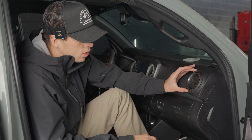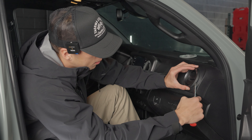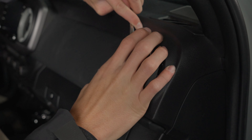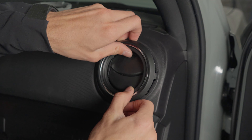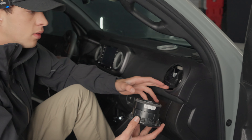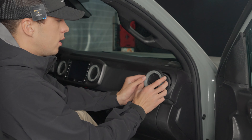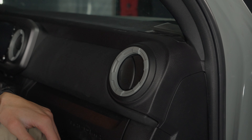In order to take this side off, you'll use a little pry tool. There are about six clips around the outside and you just kind of want to get it in here as gently as possible so you don't scratch your plastic — work it up. Once you have it most of the way off, you can use your hands and it should just slide out. Once you do this, you'll want to repeat the process that you've seen on the other rings — removing this from the housing, getting rid of the little green welds, removing the chrome piece, and replacing it with your new one. After you've removed the chrome piece and replaced your new vent ring, place it back and look for the little yellow tab on top. Place it in just like this and it just clicks back into place. That's it — you've got vent rings.